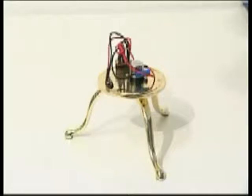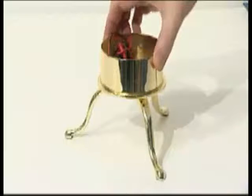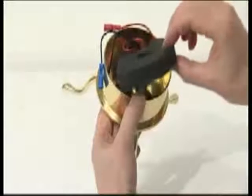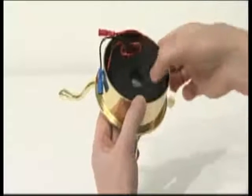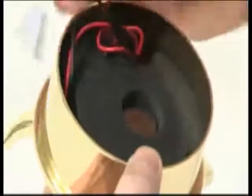Place the base unit casing over the assembled wiring. Push down and twist into the outer groove of the base plate to secure it. Insert the noise-proofing foam over the power speed controller and around the switch and power inlet socket. Feed the wire connectors up through the cut-outs.